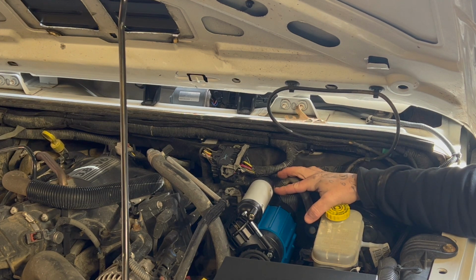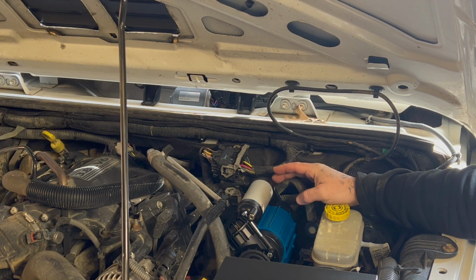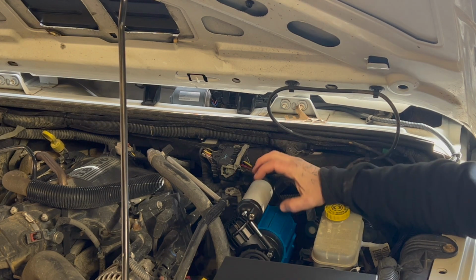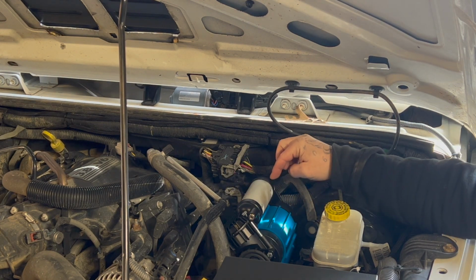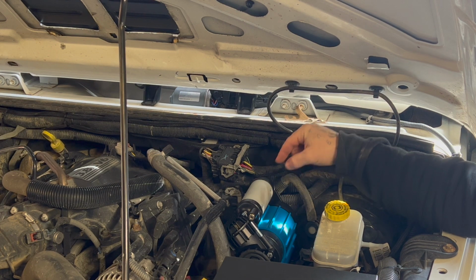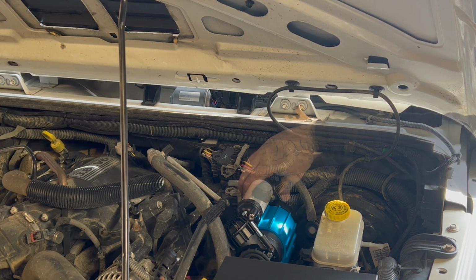One thing to note, the port all the way on the front of the housing on the black section is actually larger. This is where you're going to want your pressure switch as well as your chuck for your air line. Now, I'm going to do that last. I'm actually going to rotate this back up so I can fit the solenoids on for the lockers. And I'm going to get those on before I do the air chuck and the T-valve. Or fitting, I mean.